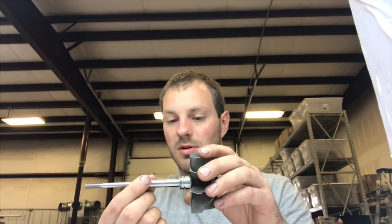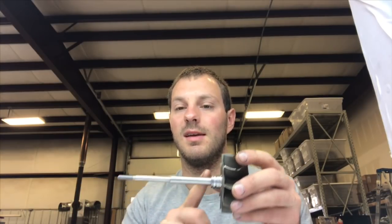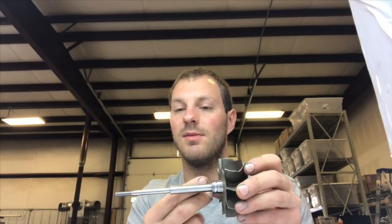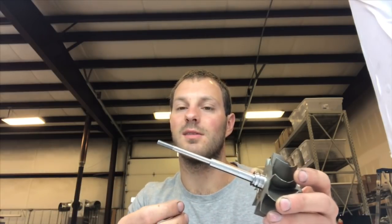What I don't like about the Gen 2 is that the shaft diameter is the same all the way through, so it's not a tight fit — the cage will slide in without pressing. As a result, I've seen some that had problems. The front bearing seems to stay okay, but the back one — I think the heat gets to it, expands the sleeve, and then the shaft ends up spinning inside the sleeve instead of spinning the sleeve, wearing out the clearance and bypassing the ball bearings entirely.